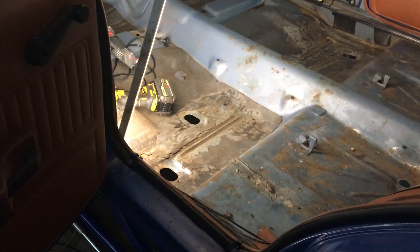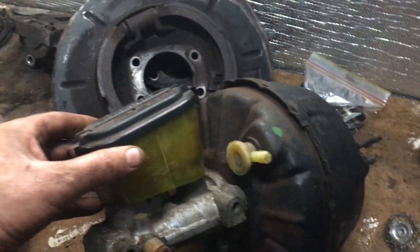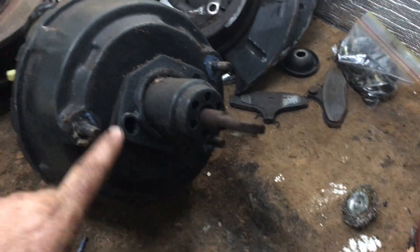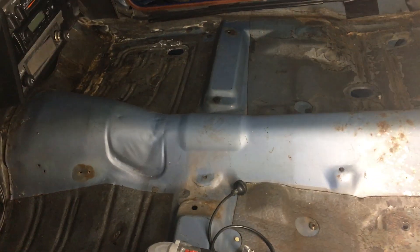The other job I had to do today was the brake booster out, because I've got to drop that off to the shop tomorrow. I'm changing it to rear disc brake. One of my little rules is that critical safety stuff — I'm not going to do myself. I'm more than capable of doing it, but it's just a little rule I've made for this project. The booster came off with just three bolts. It's got a little clip through it — you just pull the clip out, three bolts underneath, so you're lying on your back.